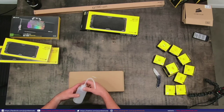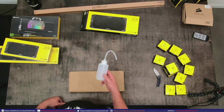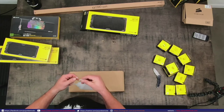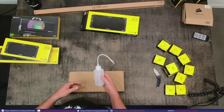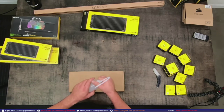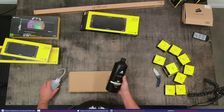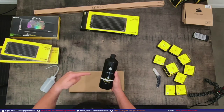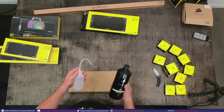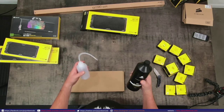You need an XL bottle. This is not even enough to prime the pump - well, it's enough to prime the pump, but the pump's going to blow that liquid out of the reservoir area so fast that you're just going to constantly be flipping the power supply on and off. When I fill up a loop I want something this big, so I can put all the liquid in at once and not have to keep filling it back up.